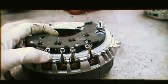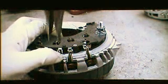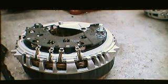Get all the leads as straight as you can and then set the rectifier straight down on them. Make sure everything is lined up — the bottom of the rectifier needs to be lined up with the diameter of the stator. Then take your thumb, push each lead back in as far as you can so it's seated back into the groove, and crimp it shut. Go all the way around, pushing each one back in with your thumb or a screwdriver while you crimp it. This has to be a pretty hard crimp. If you do it right you shouldn't need to solder, but we always solder.